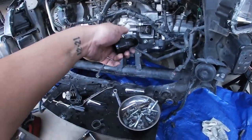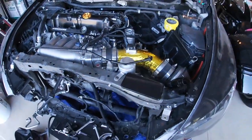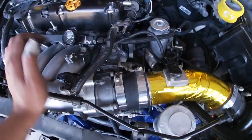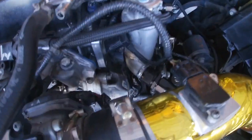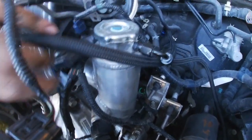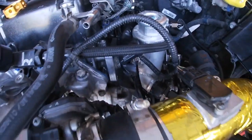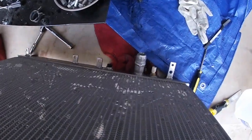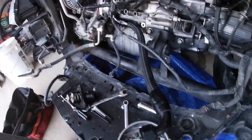Okay, all the lines are hooked up. I found a cool spot for the coolant reservoir, and here's the swirl tank — how it currently sits. I still have my stock harness so there's no wire tuck, everything's a mess, but I really don't care. That's pretty much how the swirl pot sits — it connects to the side of the head. Here's the upper hose that goes straight from the swirl pot to the top of the radiator; it has all the bungs welded and ready to go for the AN fitting conversion.